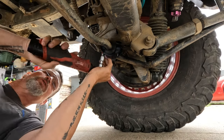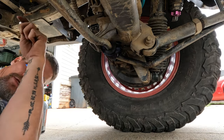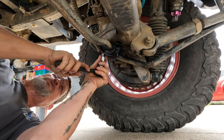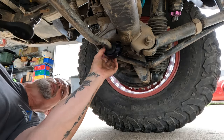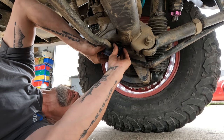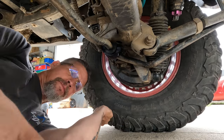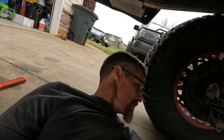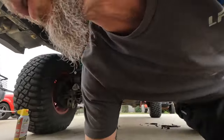I kind of want to make sure the sway bar is also centered properly. I'm not supposed to be torquing with my ratchet like that, but I'm a shade tree mechanic — what can I say. The bushing looks a little deformed, a little smashed down, but it's got it good and tight. Let's go tighten our other links up. Little tip of the day: save all this hardware. Toyota hardware is good to have in a drawer or pocket somewhere.